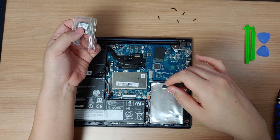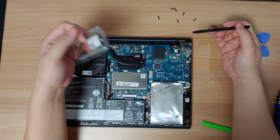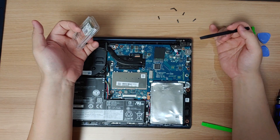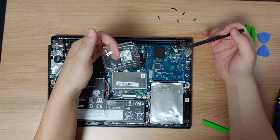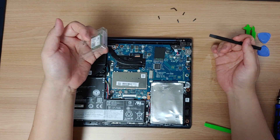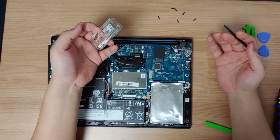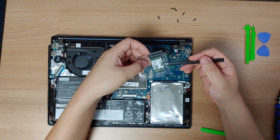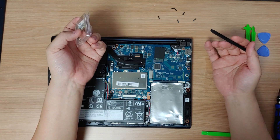Secondly, if your laptop is IBM, Lenovo, or HP, you must check if the card is whitelisted. A whitelist is a list of hardware approved by the manufacturer like Lenovo. Technically, any card with a standard interface should be compatible, but some manufacturers prohibit Wi-Fi cards unless they have tested them. You need to cross-check the FRU product number marked on the Wi-Fi card with the whitelist. It's always good to double-check with customer support or the user forum of your laptop. There are also more technical details like number of antenna connectors and the newer CNVIO standard, so make sure the replacement card is compatible before trying anything. This Intel AC9260 is not officially supported by Lenovo, but someone from the user forum said it actually works, so I'll give it a try.